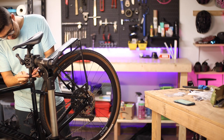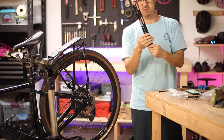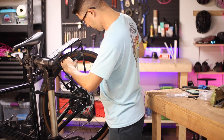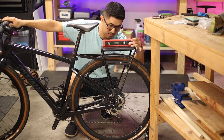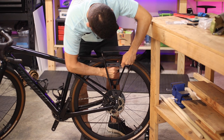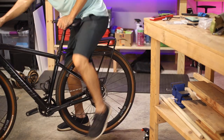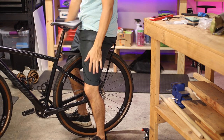Then the rack's rotational degree of freedom is constrained by the extenders, which fix the rack to either a stabilizing collar mounted on the seat post, urethane pucks which provide mounting points on the seat stays, or of course existing eyelets in the frame. Even though there's not a ton of rotational applied torque during normal use, the alloy extenders are still extremely well built and beefier than any similar stabilizer on the market. This is a super solid way to mount the rack to the bike and it eliminates the need for welded eyelets on your frame.